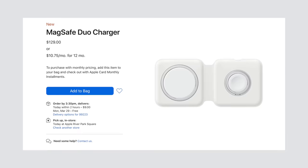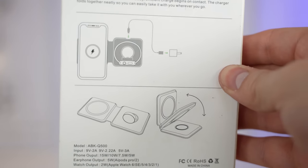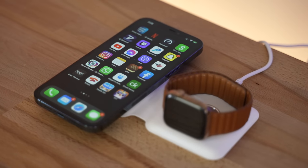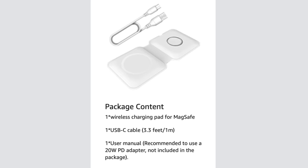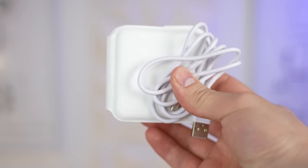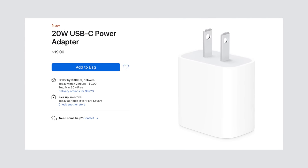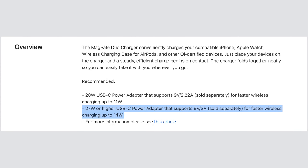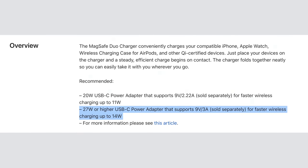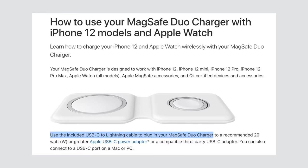The last accessory is super exciting. It's a copy of Apple's MagSafe Duo charger that costs $130. This dupe is basically exactly the same for only $35. Just like Apple's, it's super compact — one side can charge your Apple Watch while the other charges your phone or AirPods. It's MagSafe compatible, so your phone will snap to it and you don't have to worry about it being bumped off and stopping charging. However, the power brick is not included — it only comes with a USB-C cable. But Apple's $130 Duo also doesn't come with one, which is insane. And if you buy the $19 20-watt brick, your phone will only charge at up to 11 watts, not 15, because there's not enough power for the Apple Watch portion. Even with a 27-watt or higher adapter, you only get up to 14-watt MagSafe charging. The beauty of this one is that it's USB-C, so if you travel with an iPad or MacBook, you'll already have a brick and cable.